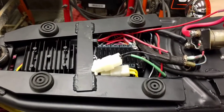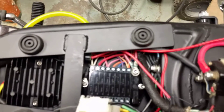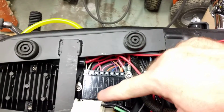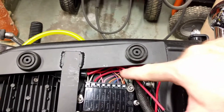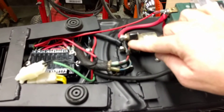I'm going to start right from the very beginning to try to eliminate any confusion here. Starter in, coming from your starter button, in. You've got a hot leg passing through, obviously, from the starter out. Starter out passes through, goes to your positive on your starter solenoid.